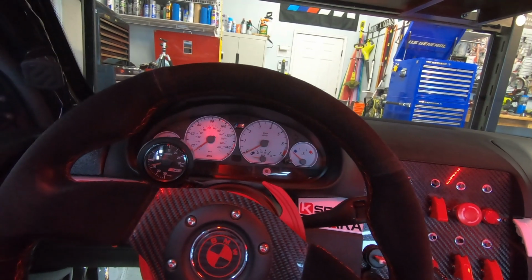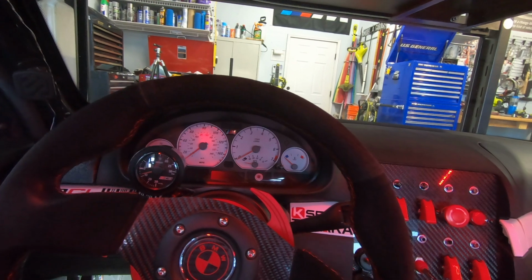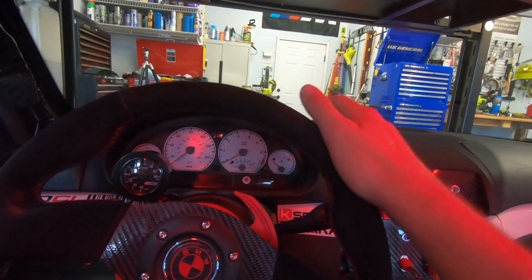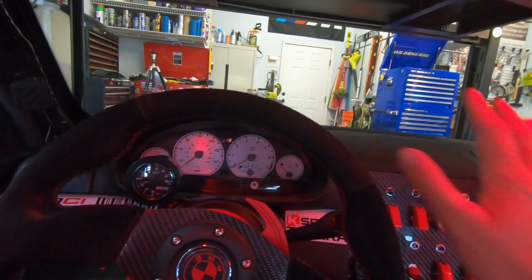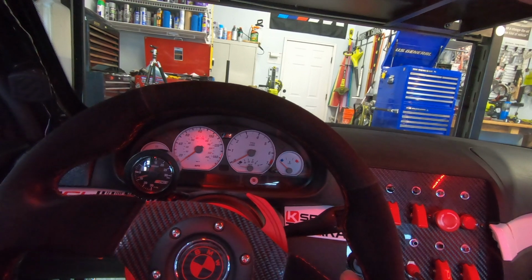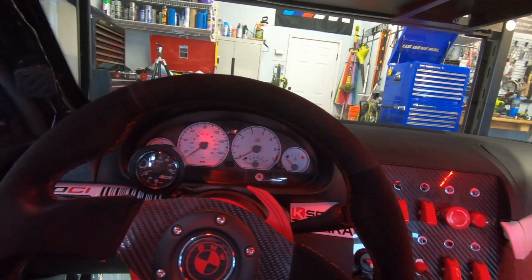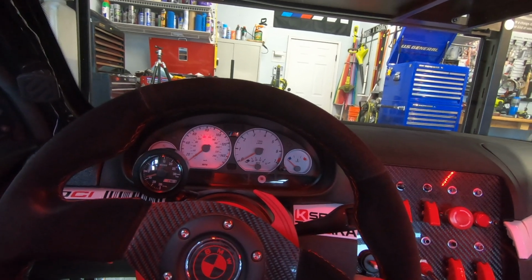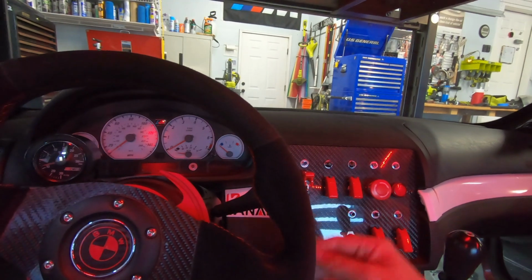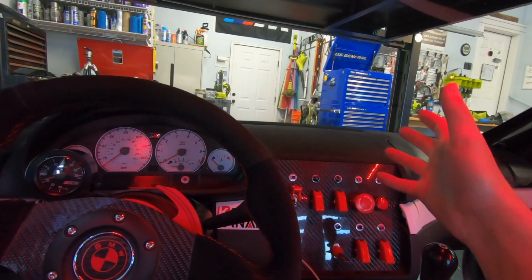I am getting a few engine lights. Revmatch can get rid of engine codes. So for example, if you delete your secondary air pump and stuff like that, he can get rid of all of those lights. And I've got a fuel tank evap leak or something like that, which I'm not super worried about because we are eventually getting a new fuel cell in this car. And then I've got a fan switch, which is, you know, I've got it here, so it probably doesn't like the fact that it can't see the fan through its own harness.